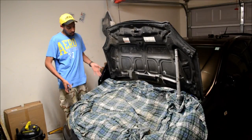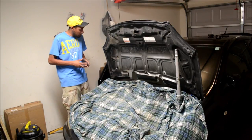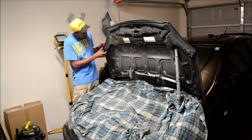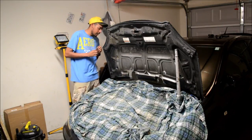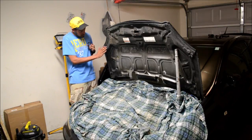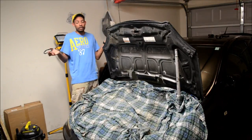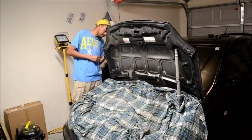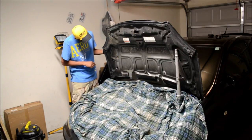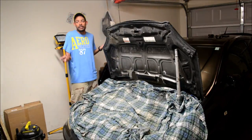Cover your engine bay because you don't want metal shavings getting into your twin turbos. I did the toothpaste method and got a little mark where it should line up. Now I'm going to take the template and figure out how I want to fit it in here, see how much to trim out at the bottom. I kind of wanted to keep the rubber stop piece, but I think I'll just cut it all out and figure it out from there.